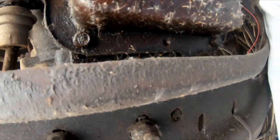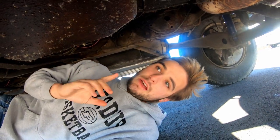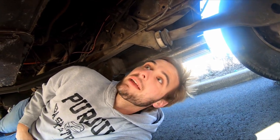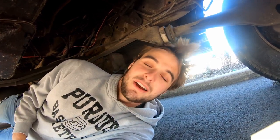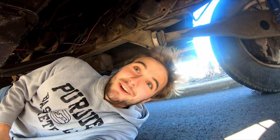Not only that, but we're missing a bolt from right under here. We're going to have to get the bolt for that and we're going to need a new gasket — I think that's where a lot of the leakage is coming from. We've also got a little bit of an oil leak, but that's just coming from the drain plug, so not the end of the world. We'll probably just need a new O-ring for it. Our biggest issue right now we think is a coolant leak — we're not entirely sure where it's coming from, but Noah found a pipe we think it's coming from. The main thing is getting a parts list so we can clean up down here, winterize this thing, and get it ready for spring when we try and run it again.